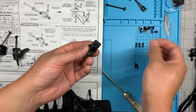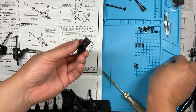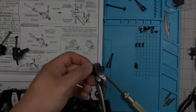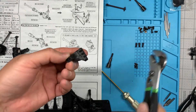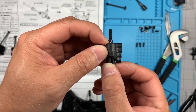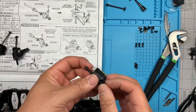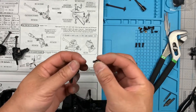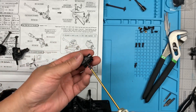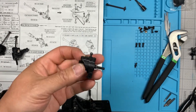The back is actually very straightforward — going to have one bearing in the front and one bearing in the back. The hole is full now so I can put the pin through. After that step there's only one more step, which is to put the ball stud — and it's going to be the black hex ball stud — onto the second hole from the front.